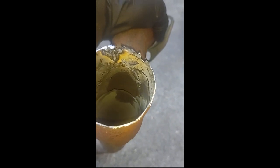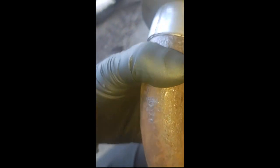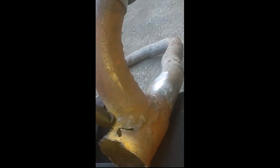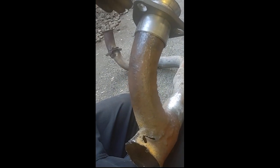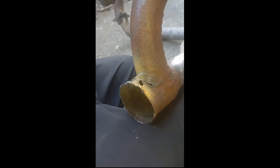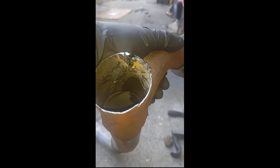It's the size of a quarter — from a full two-inch diameter pipe, the opening is barely the size of a quarter. I can't even fit a quarter in there, actually closer to a half dollar. I've got to grind that out. That's such restrictive exhaust — one side is wide open and the other is basically blocked. No wonder why you had fouled plugs on this side of the engine. It can't breathe. Even setting aside the 90-degree angle it shouldn't be at, it's totally cut off on top of that. I've never seen anything like that in my life.